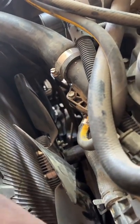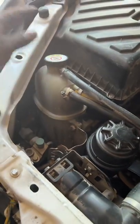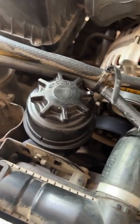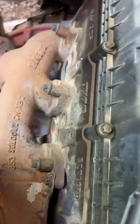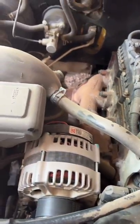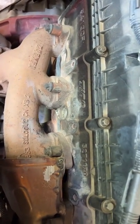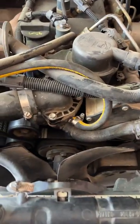You just cut it — you don't have to buy another one, it's simple work. You also have to change the side of this coolant bottle. Before, it was on the right-hand side, but I need to move it to the other side because the space is very minimal. Another problem is the water jacket plugs — these ones here get rust and all of a sudden start leaking, so you need to replace them.